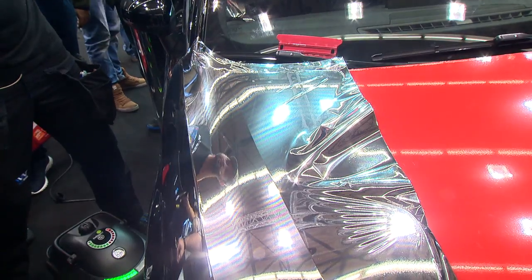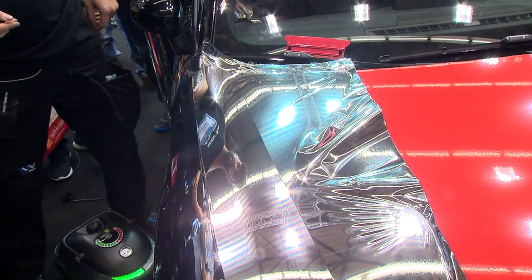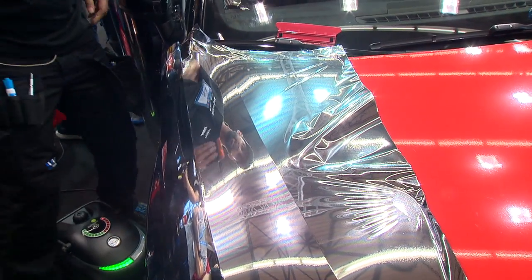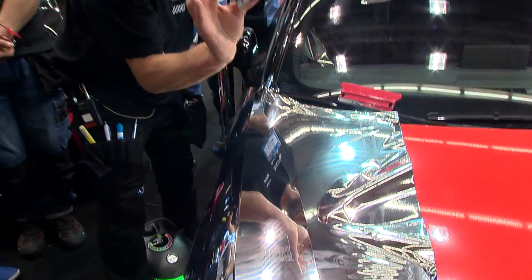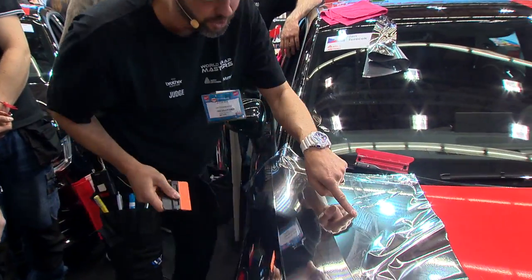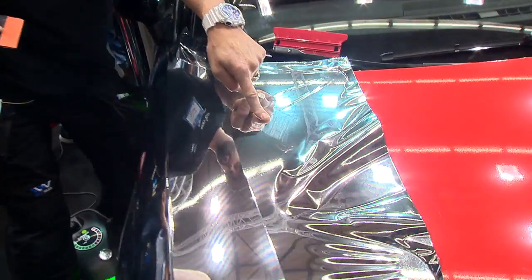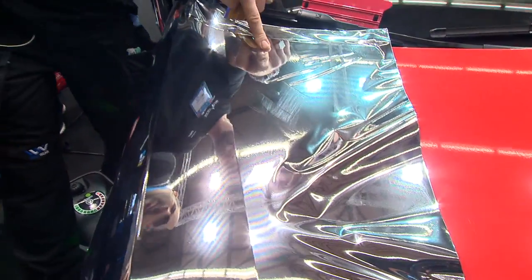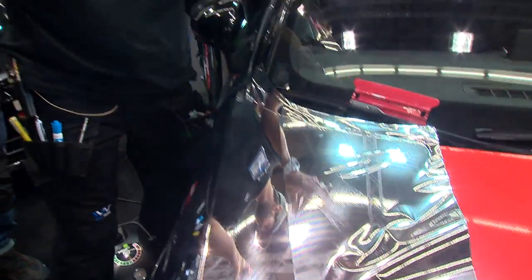So now I take a wet edge squeegee, which I don't have, but John has. And we have soap and water somewhere, okay? Because right now, if I squeegee, it gets scratches instantly, okay? And if I use my monkey strip, I might not get as many, but I still get scratches. This is when you want to use soap and water.